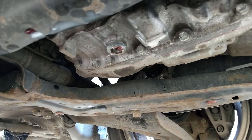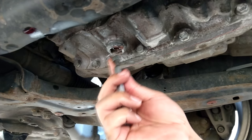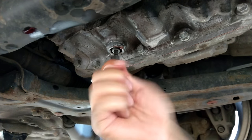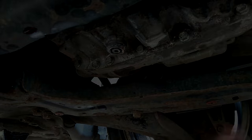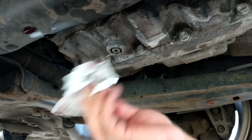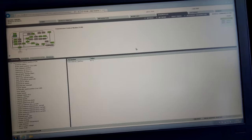Because I've been quite conservative with how much I've put in — not four liters each time since I had only 10 liters total — the excess that drained out wasn't too bad, around 300 to 400 ml. Then you do up the level plug — only needs to be wrist tight, about 8 to 10 Newton meters. The rubber O-ring does the rest. That's the fluid now in the box which, after three drain and fills, is a lot better than the original. The fluid only cost 30 pounds, so well worth the effort.